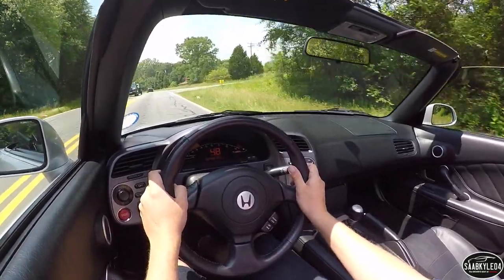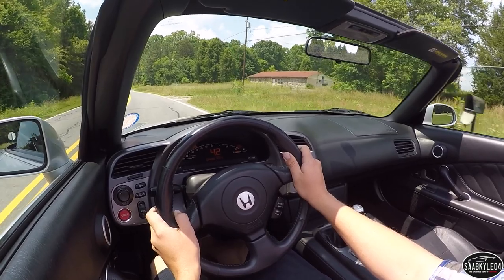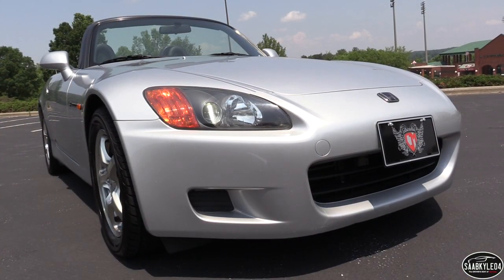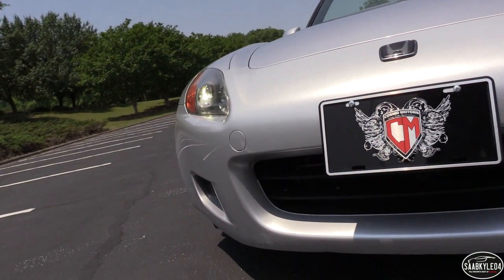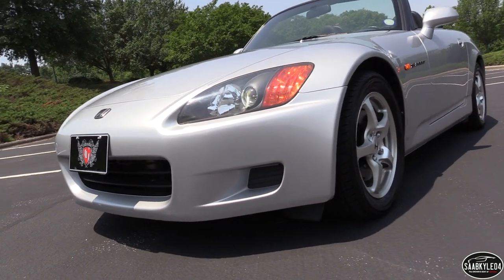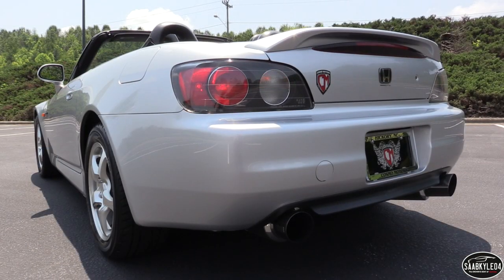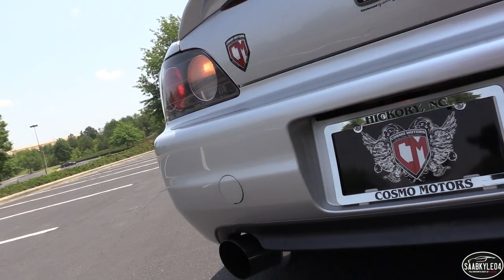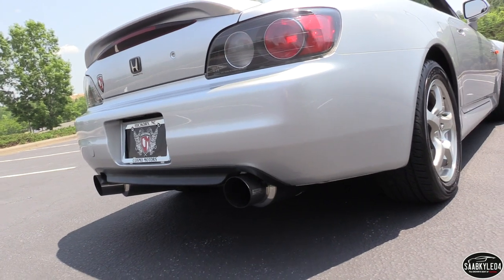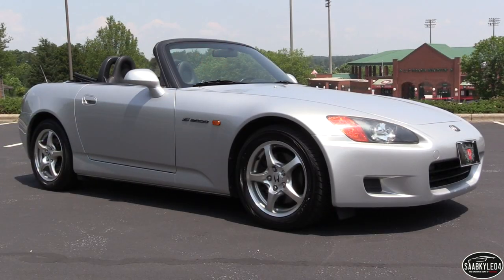The backbone is enclosed by the floor and runs down the center of the car in between the driver and passenger seat. The entire drivetrain resides behind the front suspension and deep in the chassis, leading to a near-perfect 50-50 weight distribution and a low center of gravity. Tying the frame members together with the side sills are diagonally braced bulkheads, or X-braces, at the front and rear. This is the heart of the S2000's chassis. They create a strong beam-like structure that resists bending forces and displays high torsional rigidity.